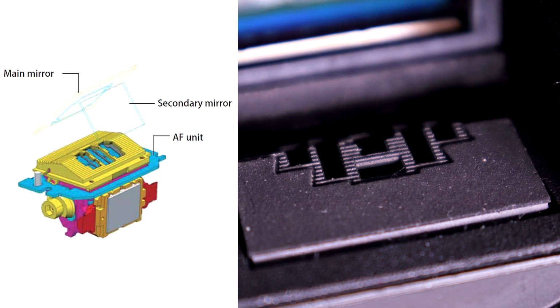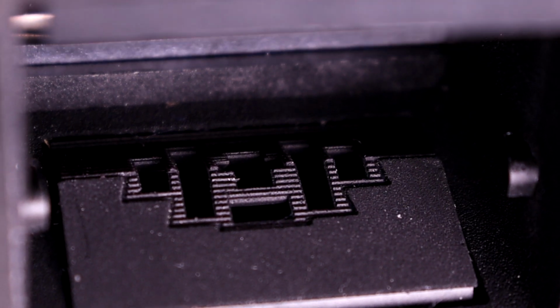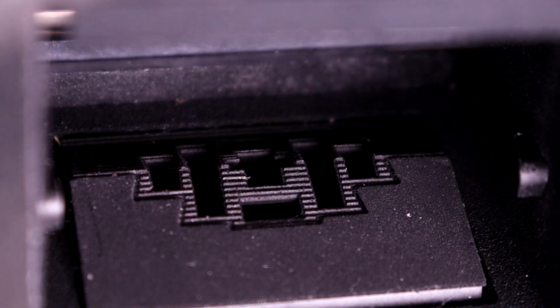If you know anything about DSLRs, you'll know that there is an autofocus system that uses mirrors, and basically it's separate from the sensor. With all the mirrorless cameras, they use stuff on the sensor to focus, either contrast-based or with phase detect sites on the sensors. But with DSLRs, that's not the case. It has a separate sensor, and if it's misaligned in some way, it's not going to work properly with the lens, the setup, and where the sensor is.